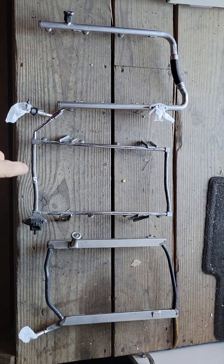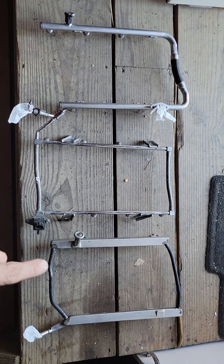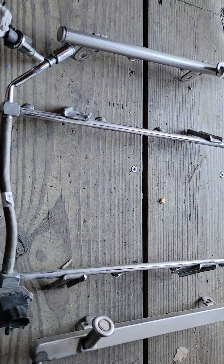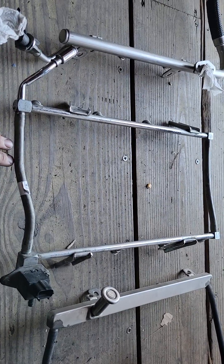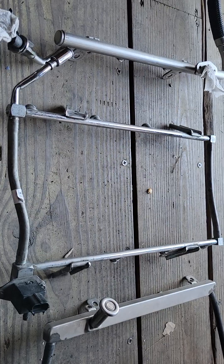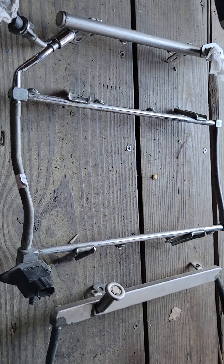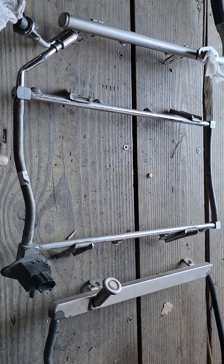What we got in the center is a Mustang fuel rail. This is a Freestar fuel rail, as well as this is another Freestar fuel rail. The significance — not making much in naturally aspirated conditions, but the Mustang fuel rail is just small when you're boosted. So for this fuel rail, you're kind of looking at just an inoptimal setup, and it's also in the way with some intake swaps where you're going to a return style fueling if you're really going to be putting some power into it.